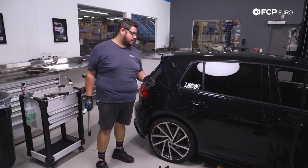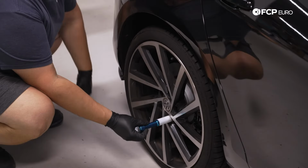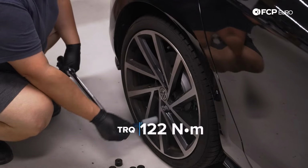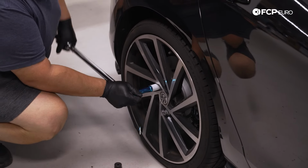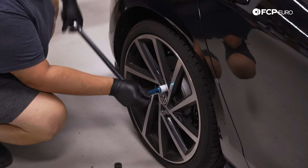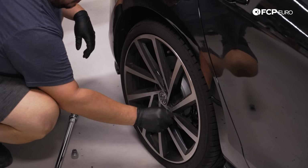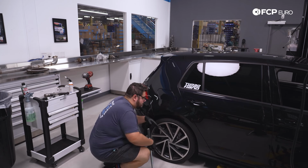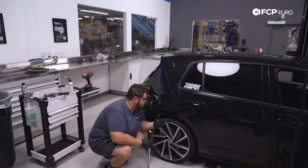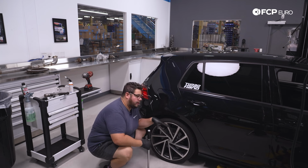Now we're gonna go ahead and torque our lug bolts down to 90 foot-pounds or 122 Newton meters. And then from there, we'll put our beauty covers back on. Always hang them in a star pattern again, whenever possible. Now that that's situated and you've done both sides of your car, let's hop inside and wrap up with the auto so that we can put our parking brake back in its operating position.